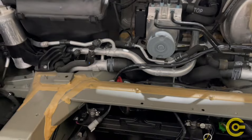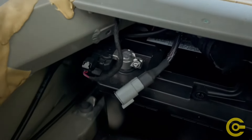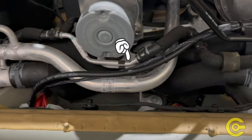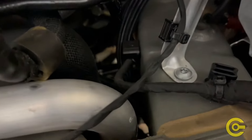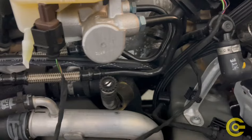We skipped ahead a little bit — the hole for the bulkhead is already done. You can see it tucked back in there. That's what passes the fire suppressant line from the bottle back to the engine bay. There's a secondary line running off the bottle that uses a grommet for the electrical system to pass through — that's also where the electrical for the push buttons passes through. The DTM4 connector is for push button activation. It's routed cleanly with zip ties around the strut tower, and a rubber grommet passes through to the interior.